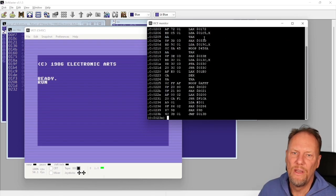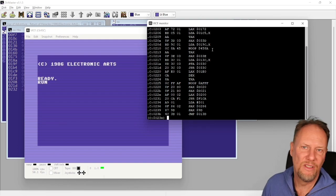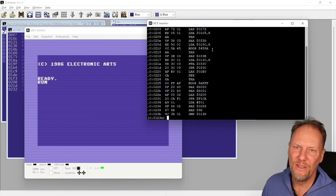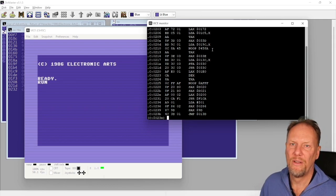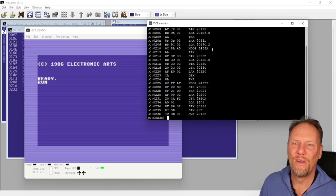And here you can see that the device monitor is handling illegal opcodes. And illegal opcodes, it's not criminal to use them. It's just that they aren't defining the actual standards. But given the 256 potential opcodes, not all of them are defined by MOS, the producer of the 6502. But if you are using the non-defined ones, most of them are sort of acting like a mix of two different opcodes.